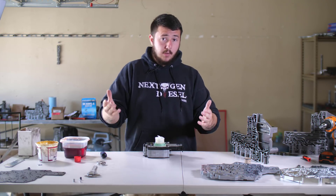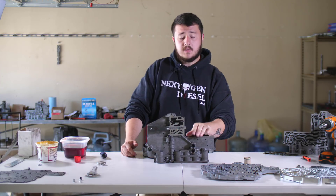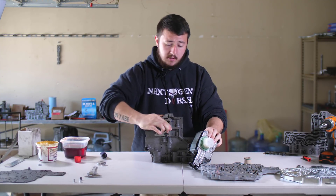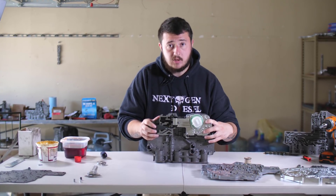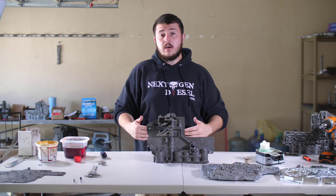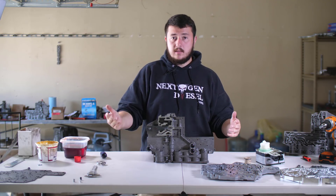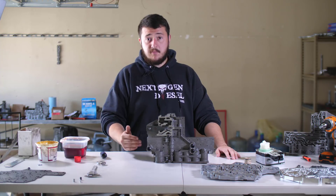While we're talking about the 68 valve body, here's something everyone should know. To explain how this valve body processes shifting gears, you can see little black areas and silver areas on the detent area. The valve body's solenoid pack sits right here and as you move the gear shifter this moves. The purpose of the valve body is to use these pins and black and silver areas to transmit information using boolean logic — basically a bunch of logic gates and yes/no states that eventually get turned into binary logic telling the transmission control module what to do. We really recommend that you get a new solenoid pack with your valve body. Highly recommend that you choose that option at checkout.